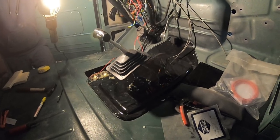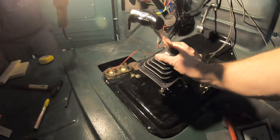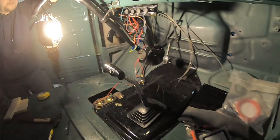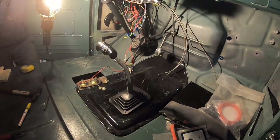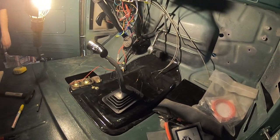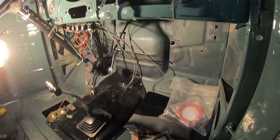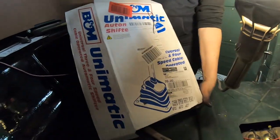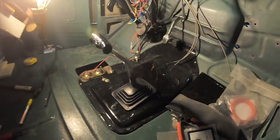Other than that, it's a pretty easy installation. The instructions are actually good, and the bolts that come with it are good. The boot looks good — we still need to drill the holes for the boot, but it didn't come with a ring. Overall, I like it. It's a universal B&M automatic shifter, and it was $300 Canadian. It's perfect for this truck — not too low or anything. We're going to stick the angle iron on and see how that fixes the floor flex problem.